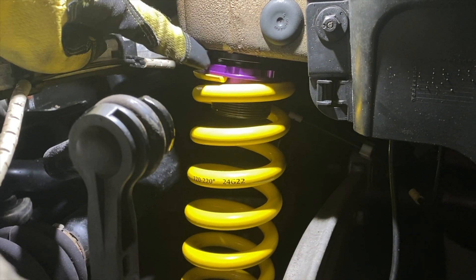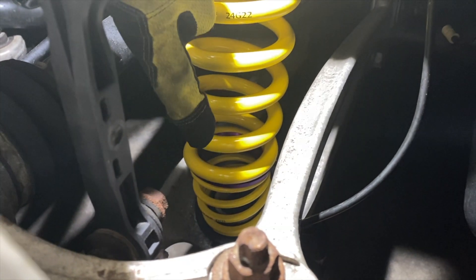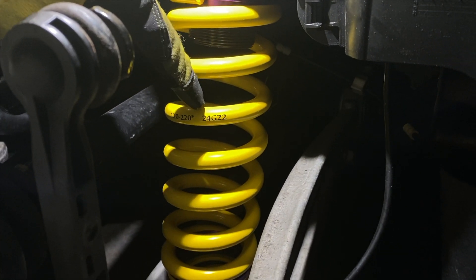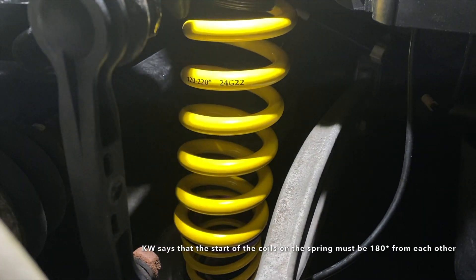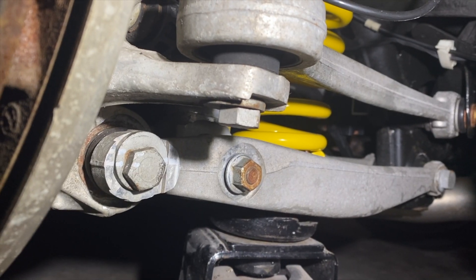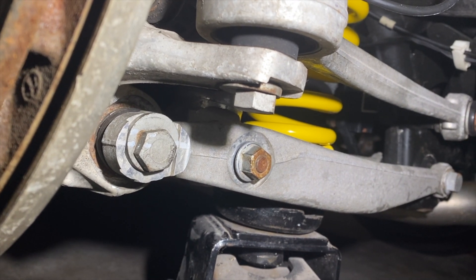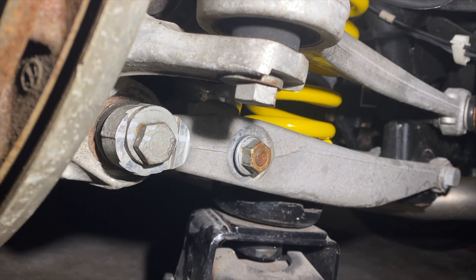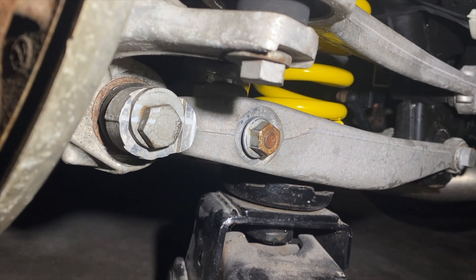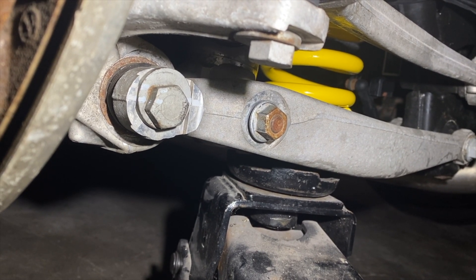I have it all cleaned up. I went ahead and installed the rubber insulator and now I'm going to install the helper spring — the numbers are legible and not upside down. I'm going to install them like that with the intermediate collar, and then install the main spring on the top. I'm going to have to compress the swing arm off camera — just push this down with your weight, slide it in, and put the perch on top. The main spring is seated in its correct location with the perch on top. So the order is: perch, then main spring, intermediate collar, then helper spring. The helper spring will straighten out when you put the swing arm back in its location. Both numbers should be legible and 180 degrees away from each other — both numbers showing towards you. You can install them in any orientation, just keep the numbers with the numbers and make sure they're right side up. Once you get the swing arm into place, it is important that you torque it at load. If you're on a lift, use a pole jack or lower it on ramps and torque it while the car is on the ground — you can't torque it at fully extended because it's going to deflect on the bushings. The bolt to the left is going to be 165 newton meters, which is about 121 foot-pounds, and the strut bolt on the right is going to be 74 foot-pounds. Torque these at load.